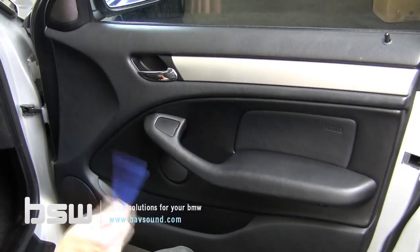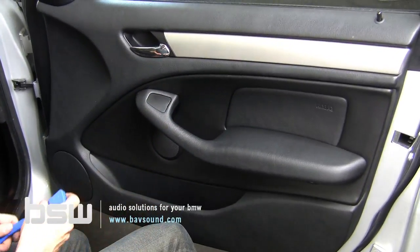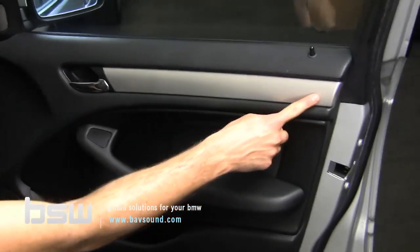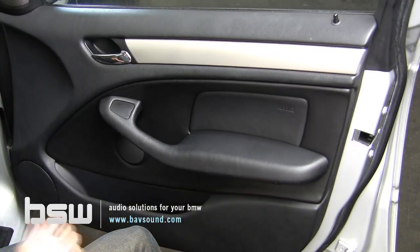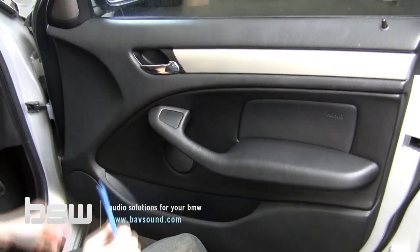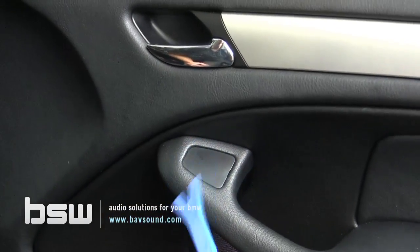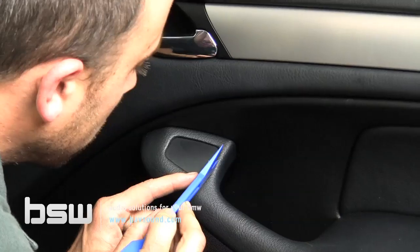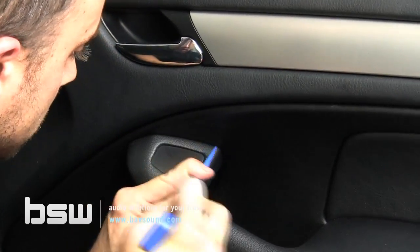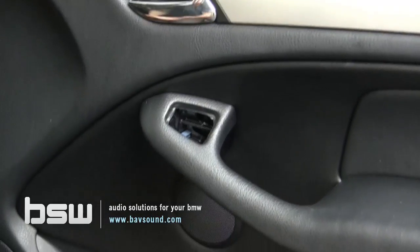So to begin, let's identify the 4 or 5 actually different mounting locations of our screws. There's a couple screws behind this panel, one behind this, and two down here. I kind of like to start with the most challenging of the pieces. So let's take our plastic panel removal tool, and again, always plastic, never metal on a door panel. There's a little lip right here we can get our tool in, and it just pops right out. So we don't do any permanent damage to anything.